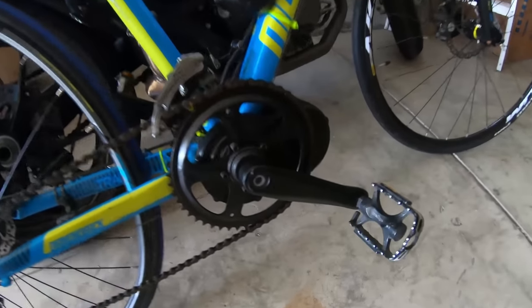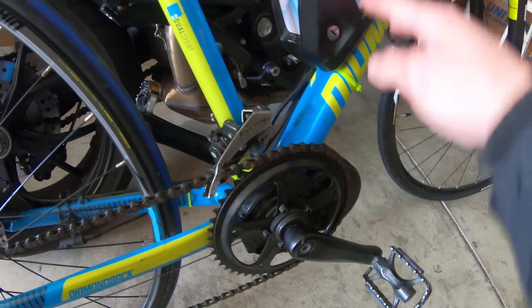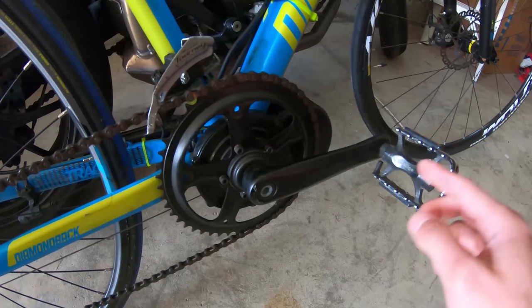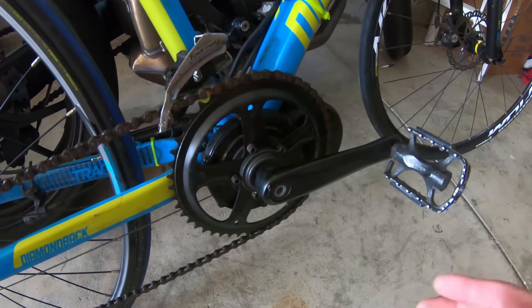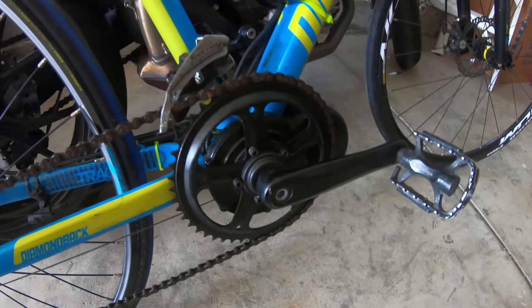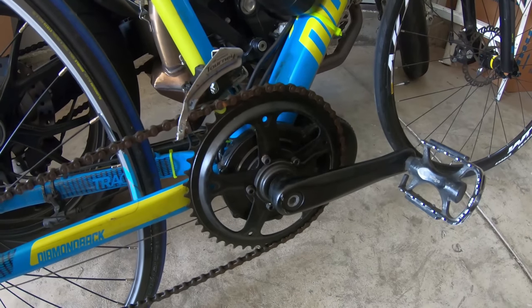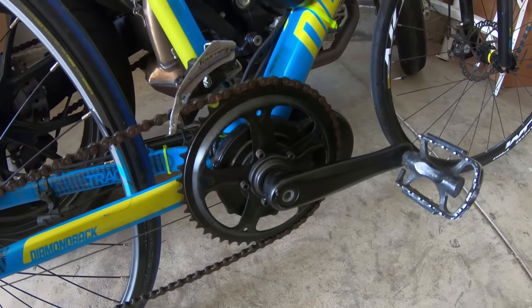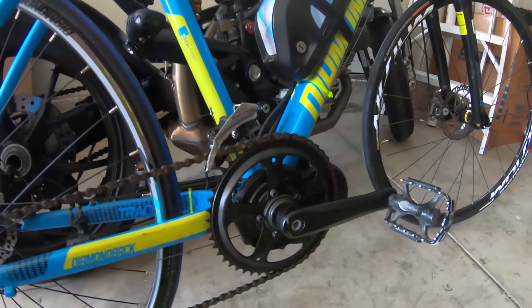This is the mid-drive motor — this is a LunaCycle one, it's 750W. There's this entire system that spins through the electric motor, and it does coast, so it can spin independently of you pedaling. You can also pedal and it'll provide power with different power assist levels. The controller has a setting from 1 through 9, but you can change it to 1-5 or 1-3 and it'll ignore the ones in between. The higher the number, the more power it provides.